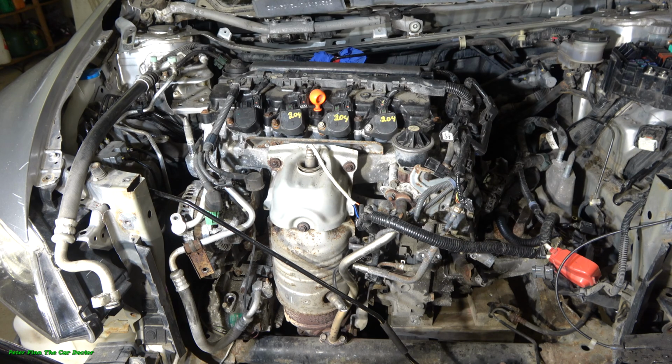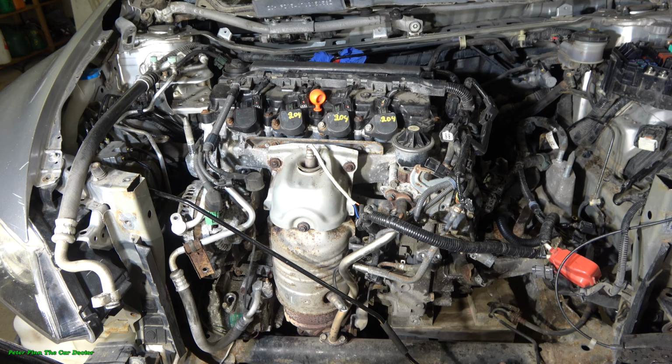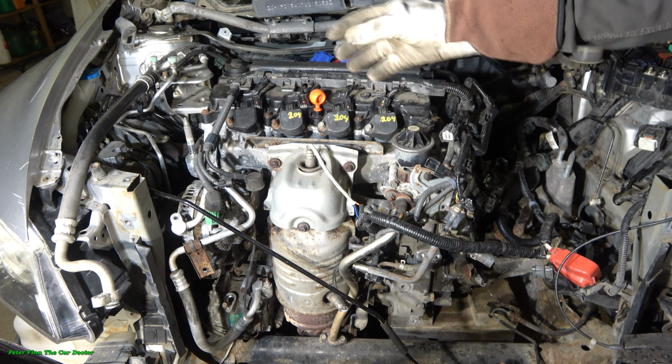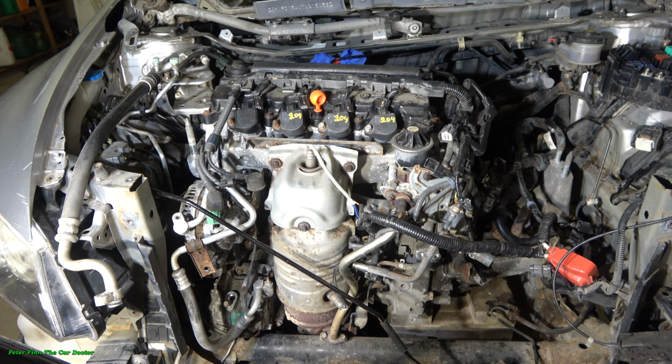Now the situation is that both engine mountings, on the left side and the right side, and in the area below the engine, are away. Next we can connect these cranes, lift and hoist these chains in here, and we can lift out this engine gearbox package. I will do that next.